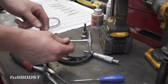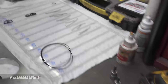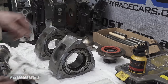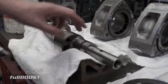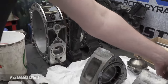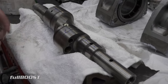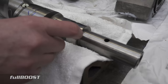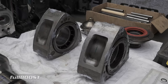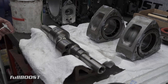Next, especially when disassembling and reassembling engines, I use an inside and an outside micrometer. This can measure the ID of the bearing, and that corresponds to the dimensions on the shaft. The difference between those two dimensions is your bearing clearance. That's important because in race engines, depending on the grade of oil you're using and if you're running higher oil pressure, you may want a higher clearance. So we measure these surfaces corresponding with the bearings in the rotor and the stationary gear to get our overall bearing clearance. If we need to alter bearing clearances, we can machine a bit off the eccentric shaft or get different clearance bearings.